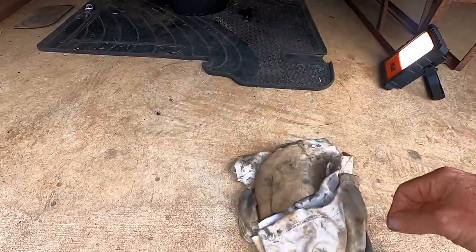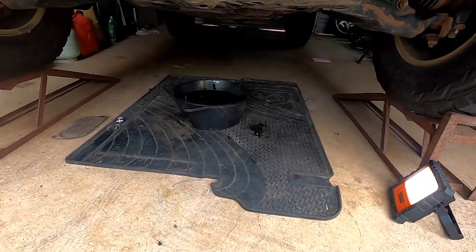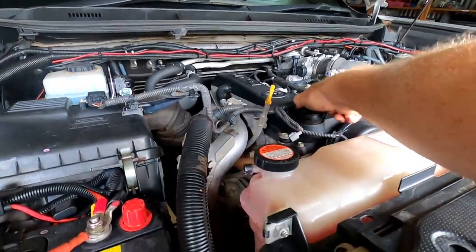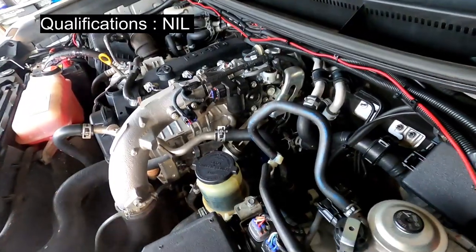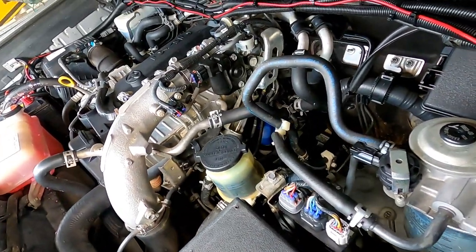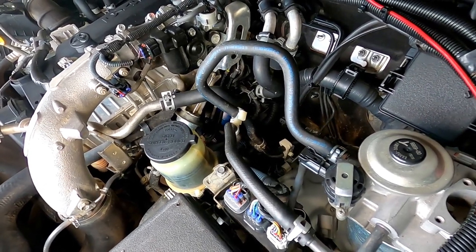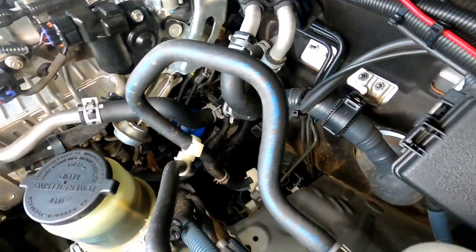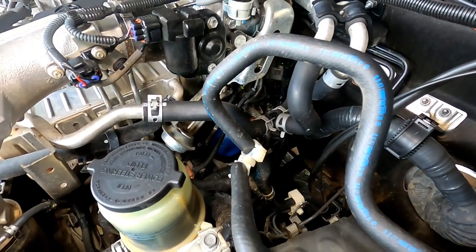The other thing you probably need is one of these — mine's looking a bit worse for wear, but yeah, you'll need a rag. Give the sump plug a bit of a wipe off. The other thing to make the oil come out a bit quicker is just take the filler cap off — that releases a bit of air in there. The oil filter is on the passenger side of the car. If you go down under the EGR and all that, you'll see a blue filter there.